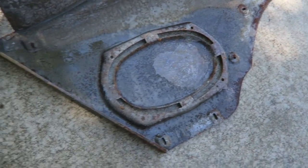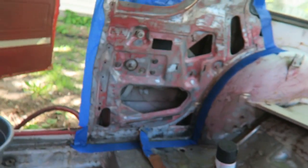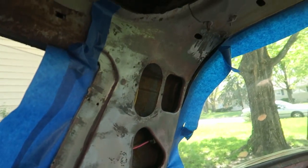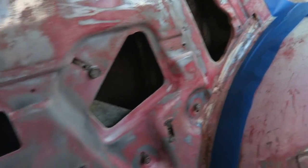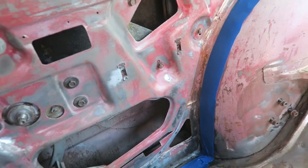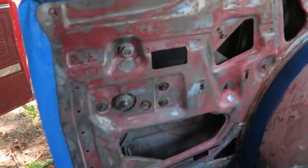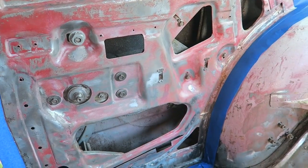I don't know how much we're gonna get done cleaning this off. Getting ready to paint this wall — as you can see, if it's red colored that means that's the old primer, because it used to be white. Some of it I got down to the steel, some of it I just went down to the old primer. It's very hard to get inside this door because there's so many crevices, but it's covered up by panels and looks pretty clean, so I'm gonna go ahead and just paint her up.